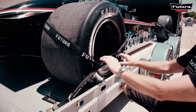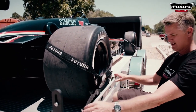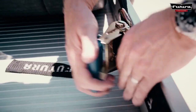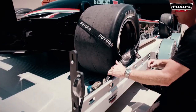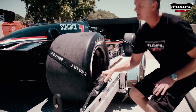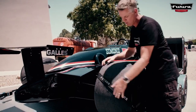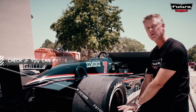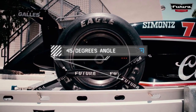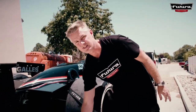It's just starting to pull back a little bit so I'm going to adjust the strap around, and that's it. It's important to note that you can't pull the strap off the wheel. If you can pull it over the top, you haven't got this set low enough. You want to make sure that's down low and you have a nice 45 degree angle, and this is nice and tight.